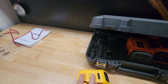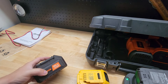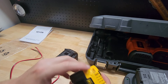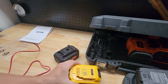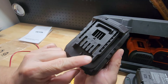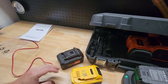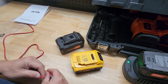I think these have just probably been sitting in a warehouse for a long time and the battery's dead. You need some amount of voltage a lot of times for these chargers to detect that the battery is on there. So we're just going to use a little jumper wire and a known charged battery. I'm going to use DeWalt since it's probably the most popular brand. All batteries have a positive and a negative, and on this guy we see negative over here and positive over here. Don't mix it up — plus to plus, minus to minus. We just want to do this for like two minutes. All we need is just a little bit of juice onto this battery so then we can put it on the charger and give it a shot.